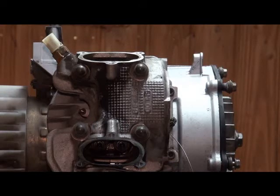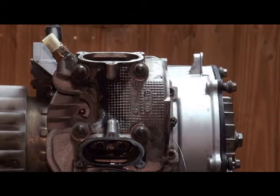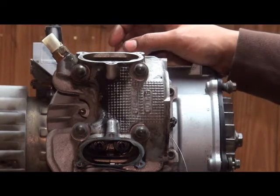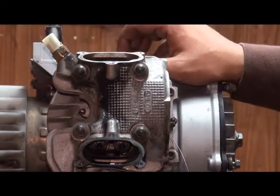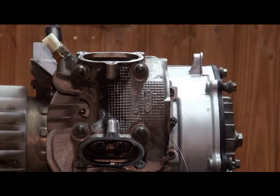On page 5-8, at the very bottom, it illustrates how to remove the cylinder head and the proper sequence for removing the bolts. Follow this sequence carefully — somebody in a white lab coat said this is a good way to do it to make sure you don't warp the head. For tightening, it is also the same procedure.